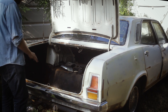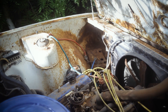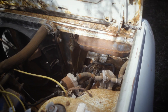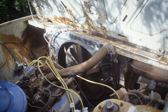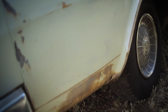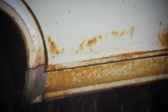Not the biggest I've ever seen, so I was a little bit underwhelmed. But still a decently sized trunk. There's definitely some rust in the engine bay — in the wheel wells on this side, along the front cowl, and some along the firewall. But nothing substantial, it's only really surface rust. There is substantial rust on this car though, so we'll get into that. Rust including the boot, wheel arch bottoms and the associated quarters — not too hard. There's a bit of substantial rust behind the stainless trim at the back of the sill. The sill itself doesn't look so bad — I think that's all surface rust.